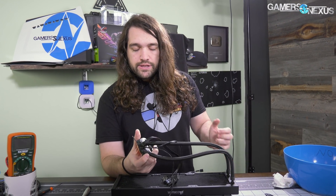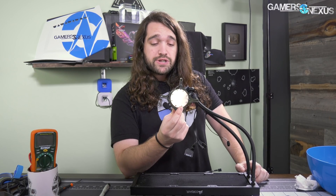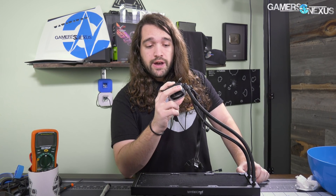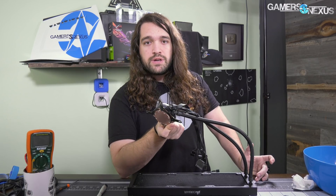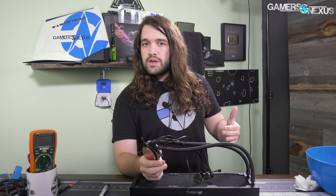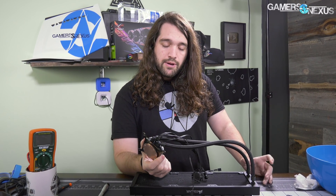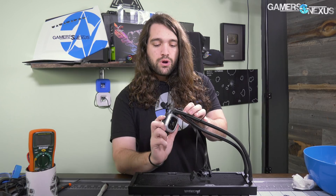Asetek has tried to correct some of that. The other big difference is the cold plate — this is a Corsair spec thing, so this cold plate is a couple millimeters smaller than the fifth-generation cold plates. That means theoretically on larger heat spreader devices like the X99 CPU we tested, you might see slight loss in performance. In our testing, this pump generation over generation is seemingly slightly worse, though we're right up against the margin of error — so best case no real advantage, worst case marginally worse.